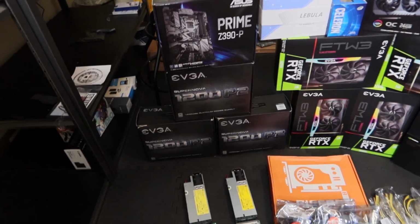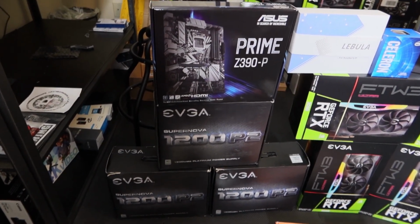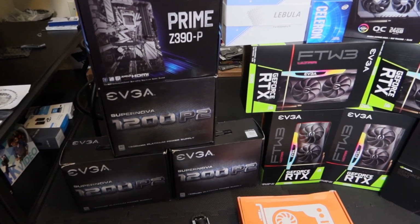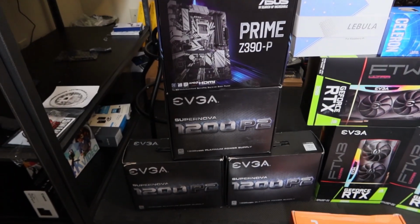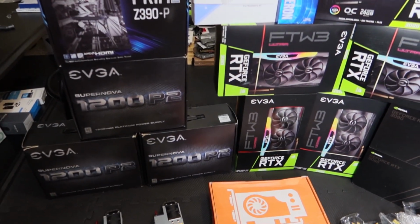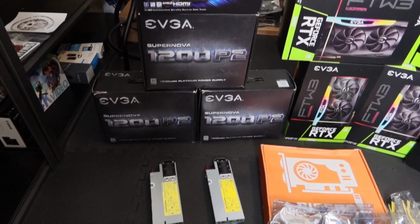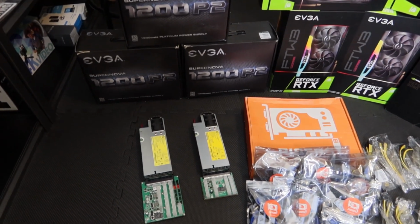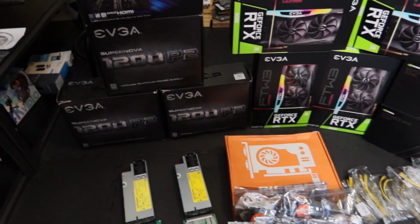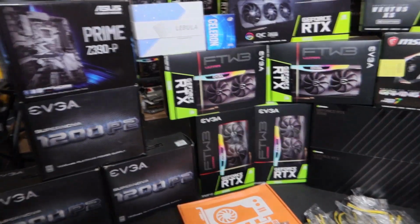And then one other thing, as far as power goes, I 100% do stay under the 80% hypothetical rule, meaning that we only use 80% of our allotted power supply in total, okay? So what that means is, I haven't decided yet, but we can go two ways with this. And this is all going to depend on how many strands I'm going to have, because each one of these RTX 3090s takes 3 8-pins, okay? So what I planned on doing was using 3 power supplies for this build, which we're going to have to. We wouldn't have enough power with 2.